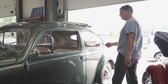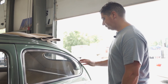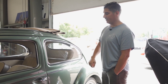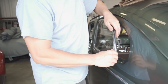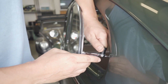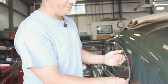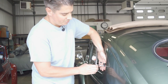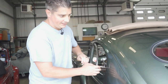Then we've got pop-out windows here. This was a dealer option. These are brand new pop-out windows available on the market today and they're pretty good quality. I do have a video on how to install these on my YouTube channel - check that out, link in the description. To close them: turn the knob counter-clockwise just to loosen it, then the handle goes in. On the inside, push the handle up against the wall and that latches. When you want it open, push it all the way out, push the elbow toward the outer part of the car, and tighten the knob so it doesn't fall back in.